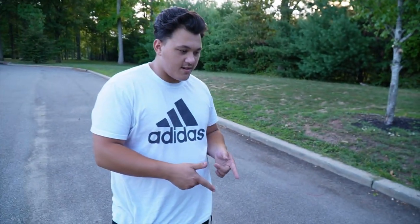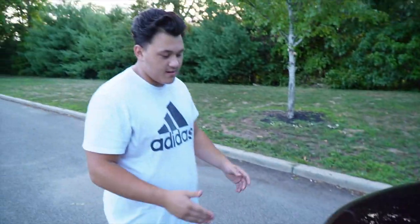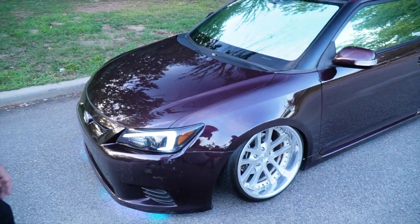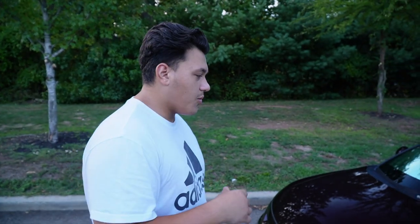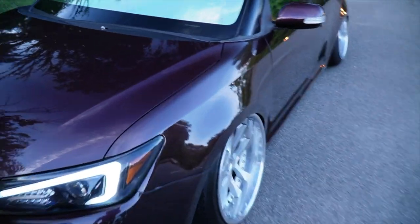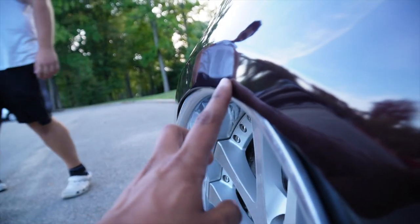What did you have to do for the front? When I first bagged it, it was sitting at negative six with just the slots and the top hat. As soon as I landed, fender to lip in the front — brand new replacement fenders immediately buckled. So I was done with fender to lip. I cut and welded the lower control arms by an inch and a half, which extended the lowers and gave about three more degrees of camber. It was still really tight — just about fender to lip. So me and EK Johnny aired the car up, shoved newspaper and cardboard, and just kept airing it out, which kind of rolled the fenders so they launched out a little bit. And they don't look clapped — they're not bacon or anything.